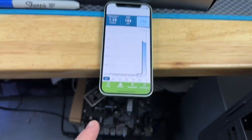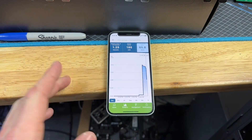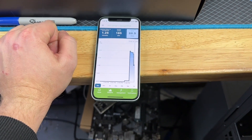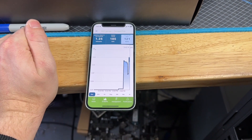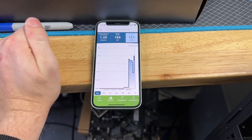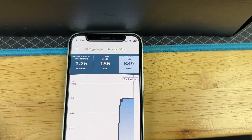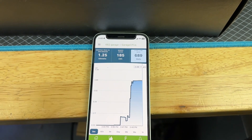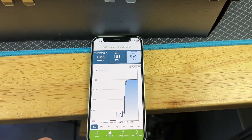I've just switched over to 240 volts on my PDU through a smart plug, so the meter readings won't be quite the same. I'm going to run this platinum power supply again — first to see how accurate the readings are, and then to get a 240V baseline. We should see a lower number even with the same load. After that I'll throw the silver in and get a better idea of all the efficiency differences between silver and platinum at 240V.